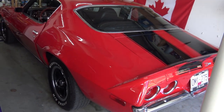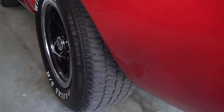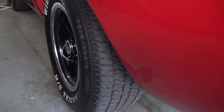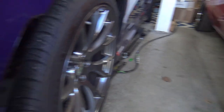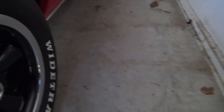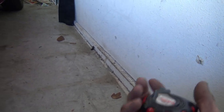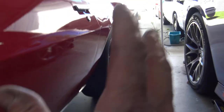The car is in the garage. One thing to make sure of — and this could be important if you have a small garage — is that part of the job requires you to remove the axles, which are about 30 inches long. They've got to come straight out. I have a wall on one side, so I needed to make sure the axle wouldn't hit it when coming out. I'm going to use my QuickJacks, which you can see here underneath, slide them underneath the car one at a time, and lift up the vehicle to make access very easy.